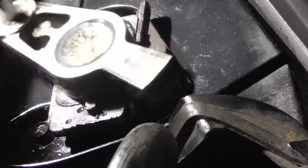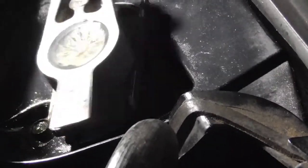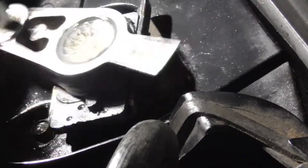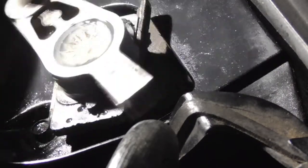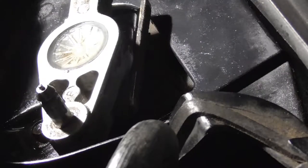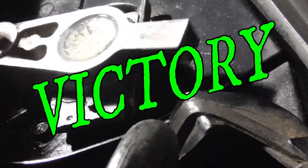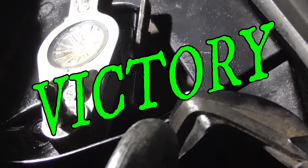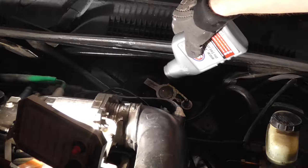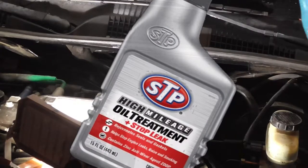Then I will see if I've had success. You now see that the rotor armature is able to park itself every time. I like to try it at least three or four times to be sure it's consistently stopping in the right position. I like this lubricant better than grease for this type of assembly — this is just simple STP high mileage oil additive. It lubricates, yet is maybe a little sticky.